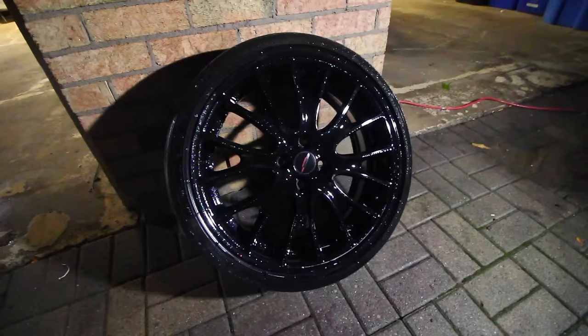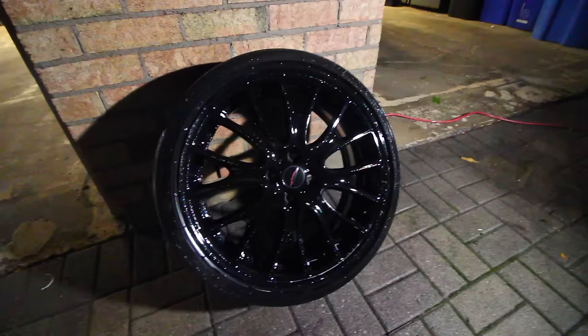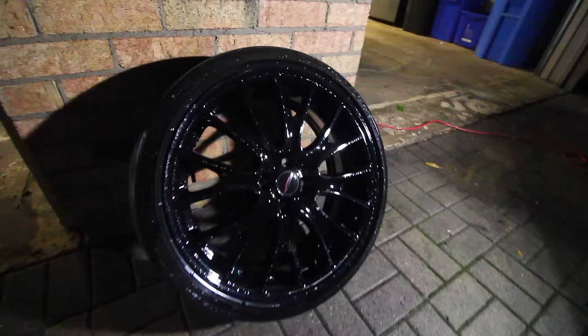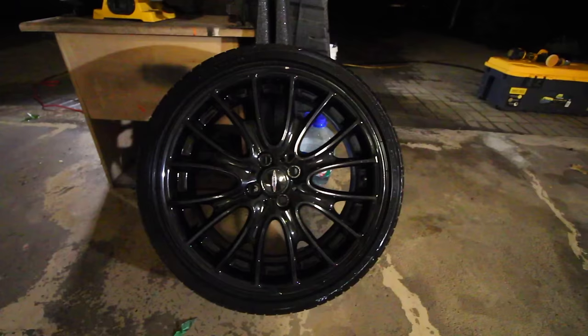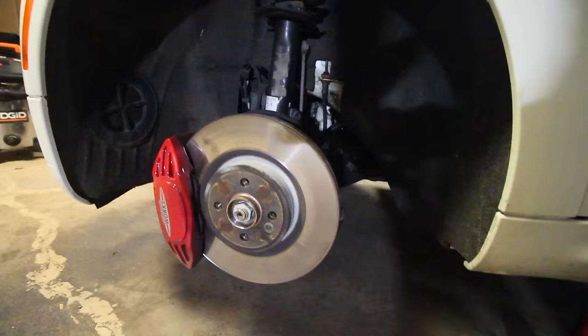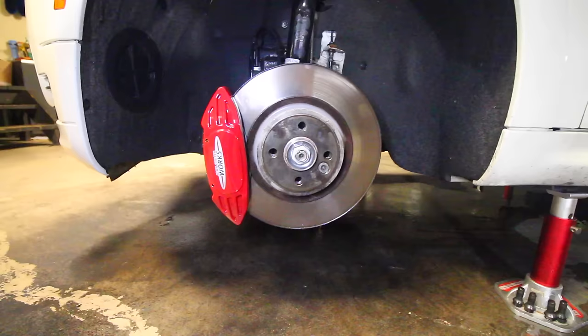Over here I've got my little station where I'm cleaning the wheels. I've already cleaned with brake cleaner, but there's still a little bit of steel brake dust contaminants — iron contaminants embedded on the wheel and some filings from the brake rotor. I'm using CarPro Iron X to get rid of it. If you want to see how I clean wheels from beginning to end, I'll have a link in the description. One of the wheels is already cleaned up — no coating, wax, sealant, or ceramic coating — and it looks a lot better. I still need to put tire dressing on it. The same cleaner you use for the wheels you can use for the brakes, and it's safe on the brake caliper, rotor, and everywhere else. A quick clean makes the calipers and rotor look fantastic.